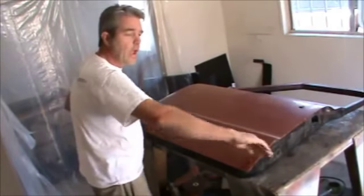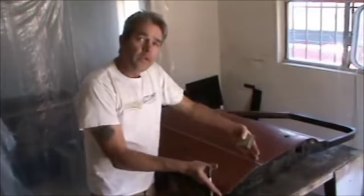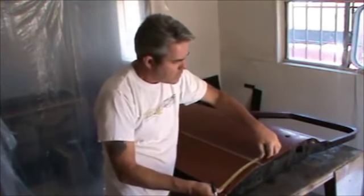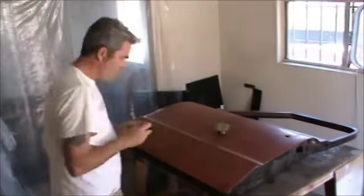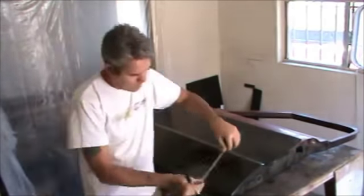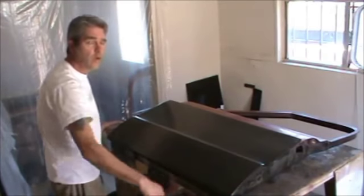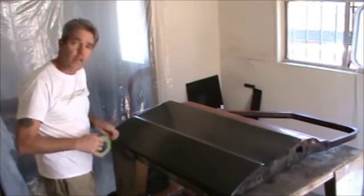Again, I'll be doing a diagonal cutout, and we'll be starting with our large piece first. Right, so I want to maintain the same bottom down here because it lined up real well with the truck. So, measure up 12 inches and mark it. So you can see this piece is pretty wide. It's 21 inches tall. You can get it at 10 inches and 14 and 21, I believe. So this time I'm going to go about 5 inches here. I'm going to go 4 inches here because my rust spot is larger on this side. I'll use some tape to help guide the line.